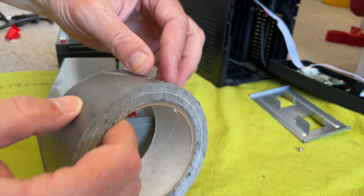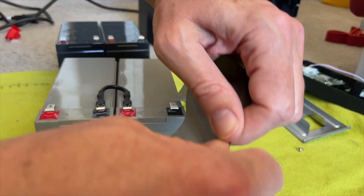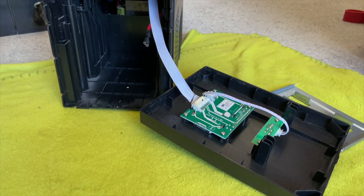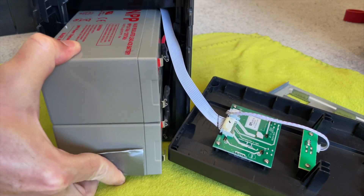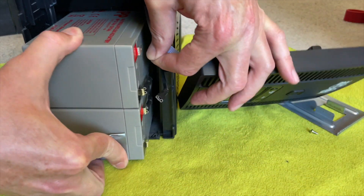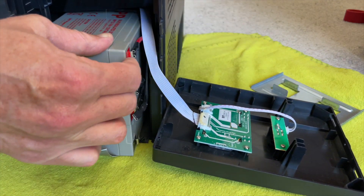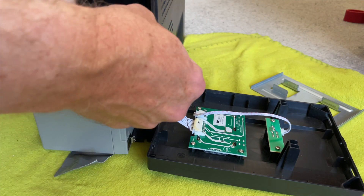Just like the previous pair had a piece of duct tape attached to make it easier to slide them out of the case, I'm attaching a halfway-folded piece of duct tape to the bottom side of the new battery combo. Get the bezel out of the way again without removing the cables attached to it, and carefully slide that really heavy combo in. When you're about halfway in, you can attach the terminals again. The upper terminal is red — attach the red cable to it — and the lower terminal is black — attach the black cable of the case to it.